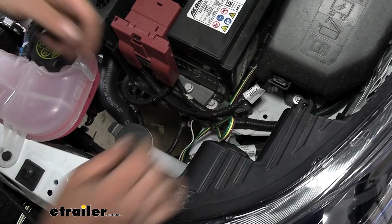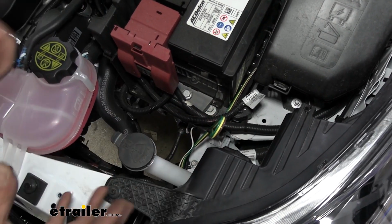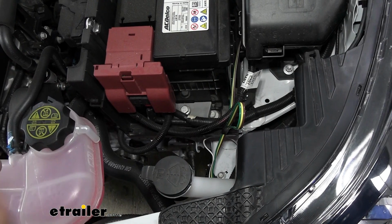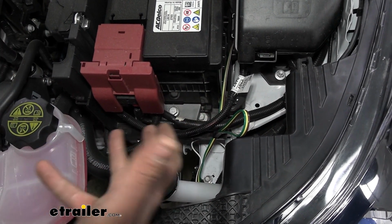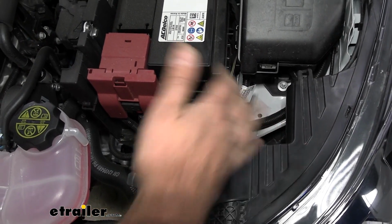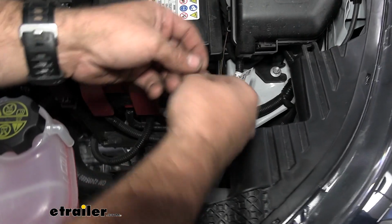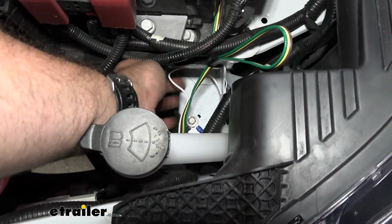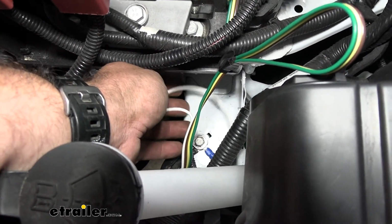Now in the engine bay, I've pulled an extra loop of wire here because some of your braking systems, as far as the InvisiBrake like we're installing here today, as well as like your Stay IN Play Duos, they tie into the diode wiring, and honestly it's not a bad thing to have just a little extra wire just in case. But what I've done, you can see this is now 3 wires, is I peeled our white wire back all the way until this ground here, and I cut the wire and I put a ring terminal on here using this factory ground.